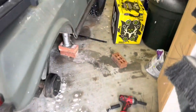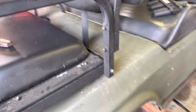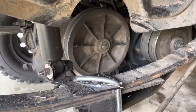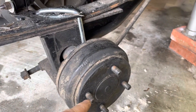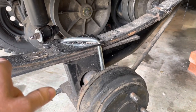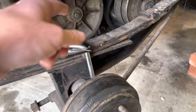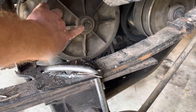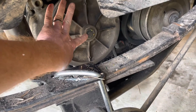To be fair, I have already removed this clutch once, so it was not very difficult. Some people have a lot of problems doing this. I've removed the back wheel — we have a lift kit on this model, so it's actually a little bit easier to get to this clutch without having to take everything apart. What you do is remove this bolt, and on these '95 models it's lefty loosey, righty tighty.